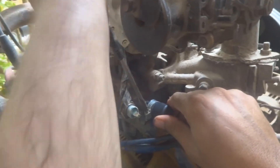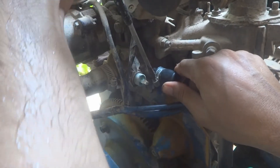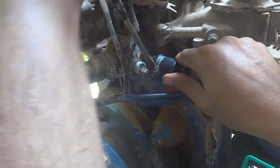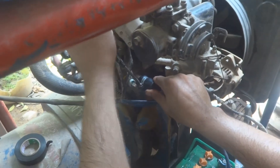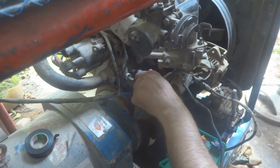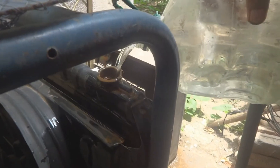We will tighten it gently so that it will produce enough pressure on the pipe or hose. Grab it gently — something like that. The main water flow will be stopped by the wooden stopper — the dead plug. So this one is now secured, and I hope it will work. I'm going to fill in the coolant again into the radiator.